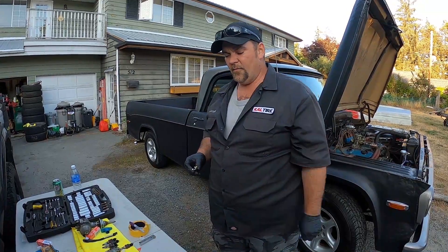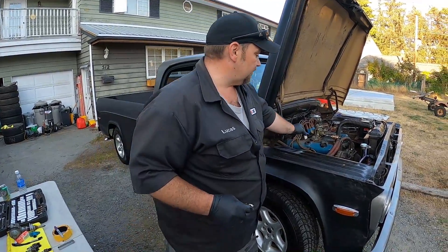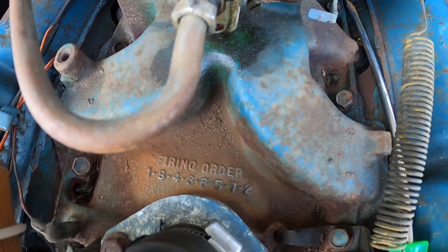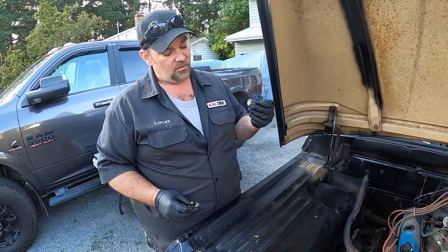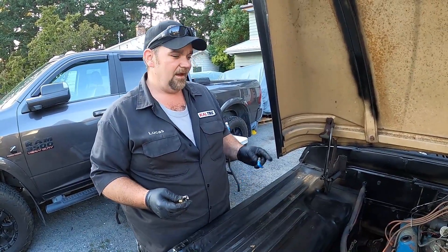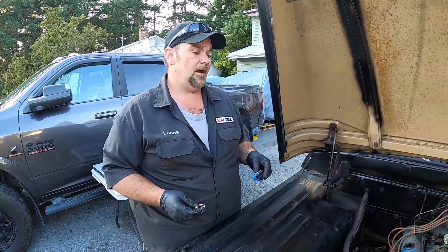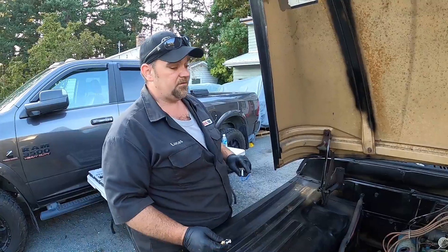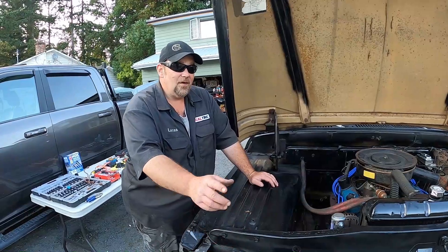All the plugs have been changed. The firing order is right there on the front of the engine — you Mopar guys know it by heart, but there it is. I like to do one plug wire at a time. The problem is the parts store gave me points and condenser for a 383 Dodge truck — that's usually what I order. I've looked at the points on here and the outer coil condenser will hold, so we're going to sand and check the gap on the factory points, put a new cap, rotor, and wires on it, and go have some fun.